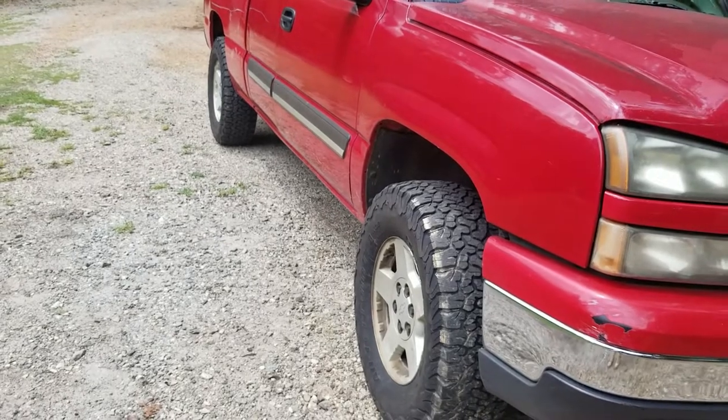That's it for the video. If y'all want to play the used tire game: make sure you get them as cheap as possible with as much tread as possible, make sure the date code's good so they last a while — because if you have to get them balanced and aligned again within the year it's gonna be super expensive. Make sure they're the right size, make sure there's no dry rot or cracking, make sure they're not cupped. Just make sure they're not crap tires — good price, good tread. It's not that complicated.